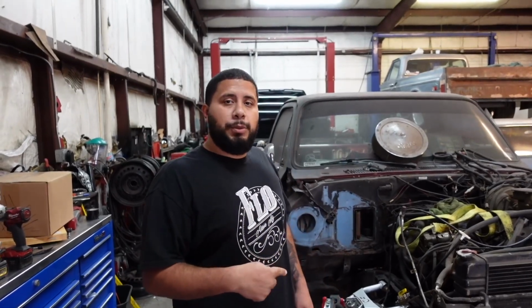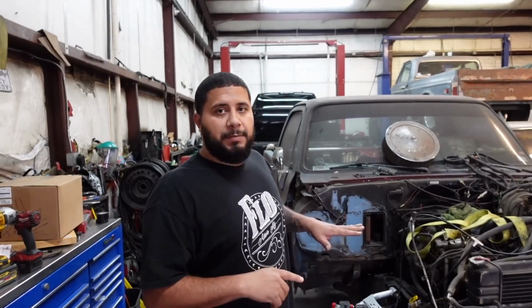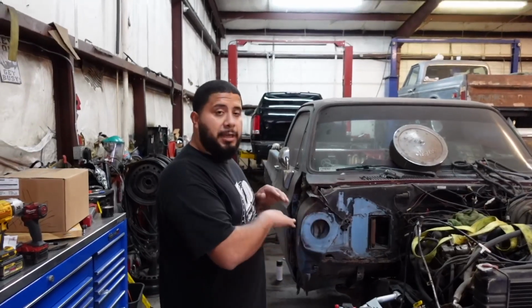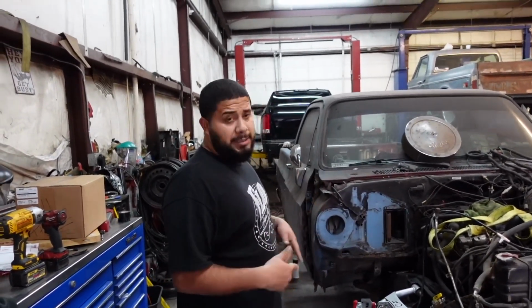So we're almost ready to put the wheels back on. We're fixing to drop the truck to see how low it's gonna go. I had posted some pictures on Instagram on how it sat without the Z and without notching the frame on the bottom. So the Z is done. We already dropped the front frame horns. We already did the back, and we already notched the whole frame. So here in a little bit, we'll put the wheels on. We're gonna sit it on the floor, see how low it got, and then I'll keep y'all posted on that on the next video.